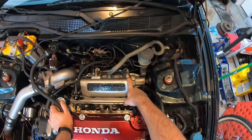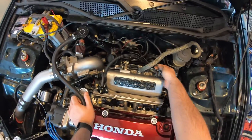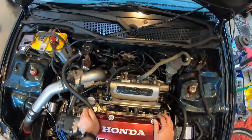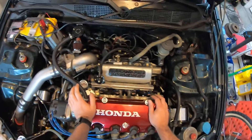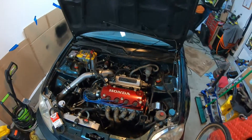Another thing to note: you want to run an OBD1 air intake sensor. I just grabbed one off a car at the junkyard and spliced it into the factory wiring harness. You'll see my original sensor is still down there in the intake tube, just so that hole is plugged up. You really want to get those intake temperatures and read them correctly because it hugely affects how the car runs — if you're running just the original one it never sees the heat that the supercharger generates.